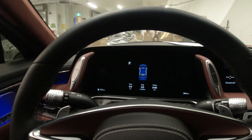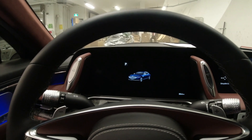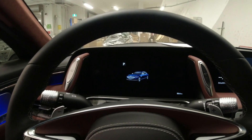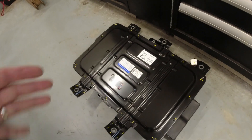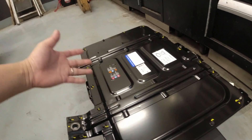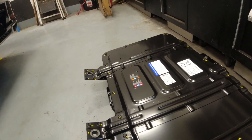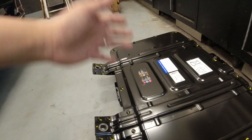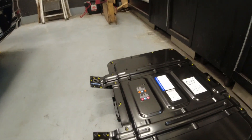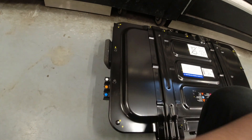I diagnosed this and believe we have a problem in our 48 volt system that sits on top of the 12 volt system. Today we're just going to be replacing that and confirming our fix. The 48 volt unit is this part here — I think they sent it from the head office, possibly from another vehicle. We couldn't get this part for a long time. During my diagnosis I was checking the connections, especially these three wires: power coming in, power coming out, and ground.